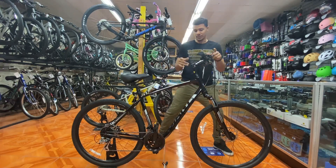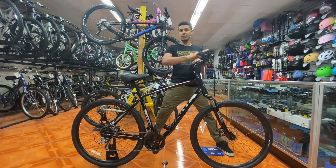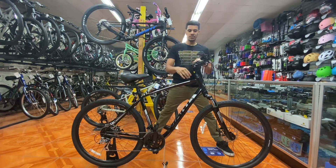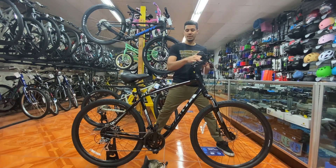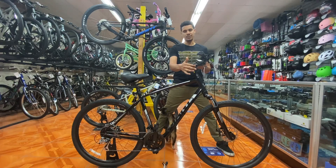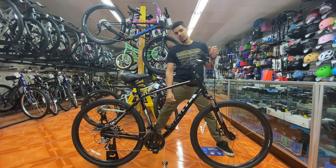You also get a really cool feature: an adjustable stem. For a comfort bike, an adjustable stem is a huge plus. You can pivot the stem completely vertical or angle it all the way down. As you raise the handlebar up, it also makes the bike feel shorter because the handlebar comes closer to you. You can figure out your perfect position just by loosening a 6mm Allen key. The stem is a quill stem, so you can also raise it up from the quill itself — right now it's about halfway up, so there's still about an inch to an inch and a half to go.